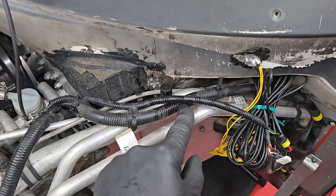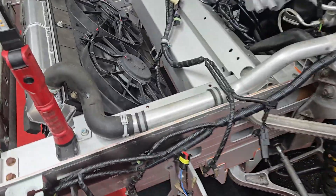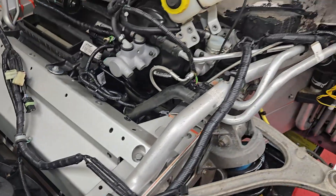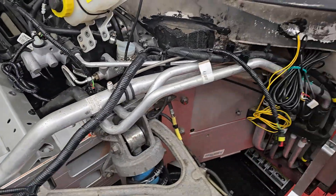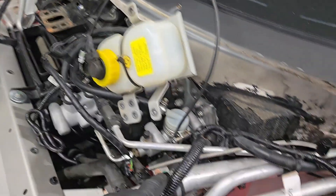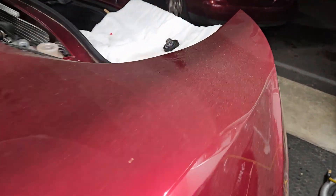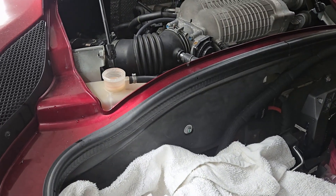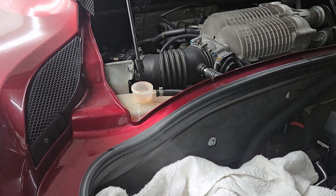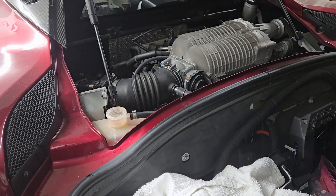I also recognize that there are bleeders here for the heater core, so I'll be opening those as well. I'm hesitant to call this done because I can still hear air kind of sloshing around the system, but I've bled it as much as I can without actually starting the engine. So the next logical step is just to run it and continue to try to bleed it from there. I did power bleed these under pressure — got a good amount of air out of both sides and topped off the reservoir. Got about three and a half gallons in. I'm going to stop with the cooling system, get back to the oil line and power steering, and hopefully start this thing and keep bleeding it tonight. Subscribe and I'll see you in the next one — thanks.